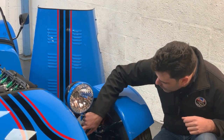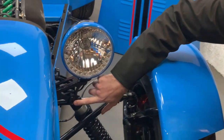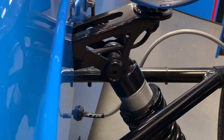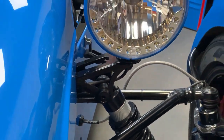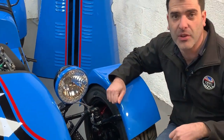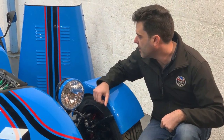We've got new little fittings, so on all the bolts now, rather than having a hex head bolt and a nut cover, we've now put in our own dressing kit, so we're using a countersunk bolt and a nice aluminium insert, so it's got all the correct radius for IVA, so you're not having to trim. So there's a few little tweaks and bits we've done on the car that just make IVA so much easier. That's all standard on the car.